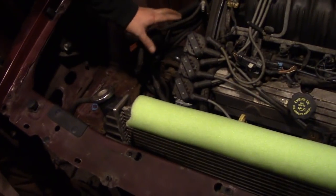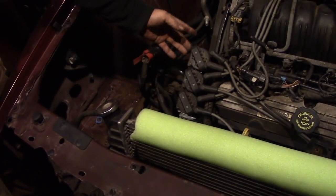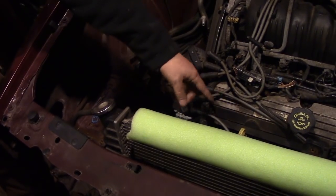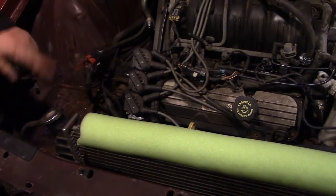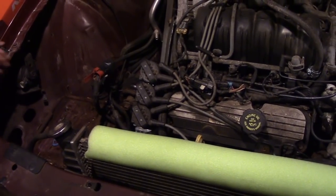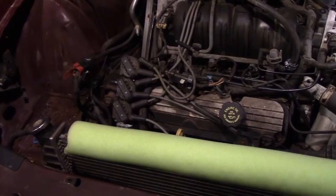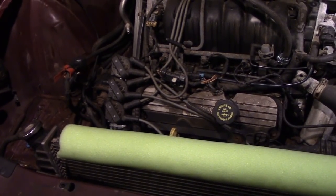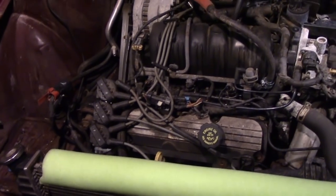Words of wisdom: when you go to move your coil packs, they're grounded at some point underneath on this plate, so make sure you run some extra grounds back to the plate. You also need to replace the first three plug wires because they've got to be longer to go to the back. We're used to doing that by now, but just don't forget — I hate for people to yank it apart and then realize they don't have all the parts to put back together. Good deal. We'll see you all on the next video. Appreciate you following along. Get goosed.